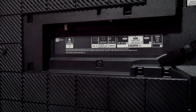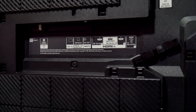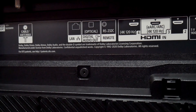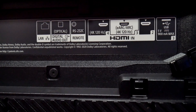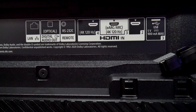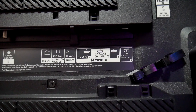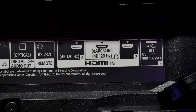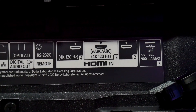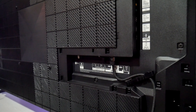So the ports are located on the left hand side of the TV and we have the cable antenna port, LAN port for internet, optical for audio, the remote, and then we have port number three and four which are HDMI 2.1. That means that it supports 4K 120Hz but one of them is going to be eARC, meaning we'll have to use only one left for consoles and the other for audio. Then we have port number two which is regular 2.0 and then we have one USB port.